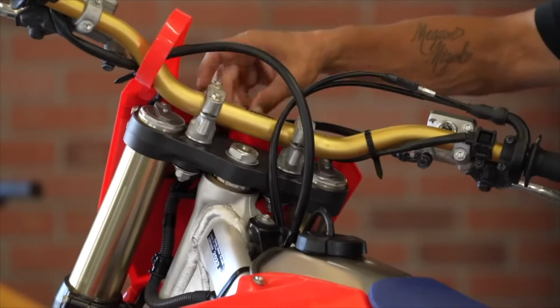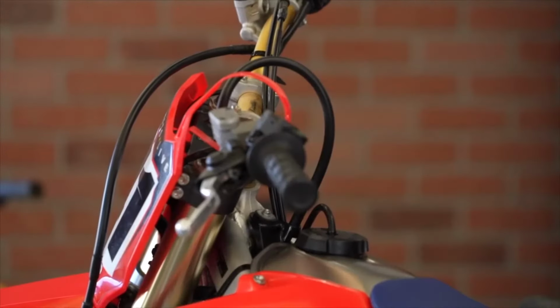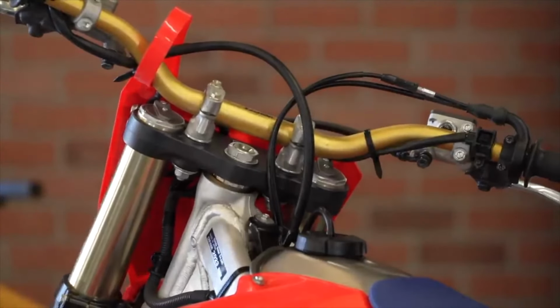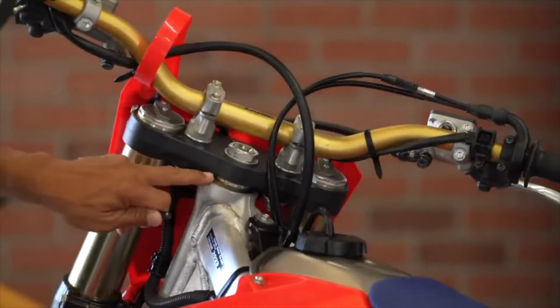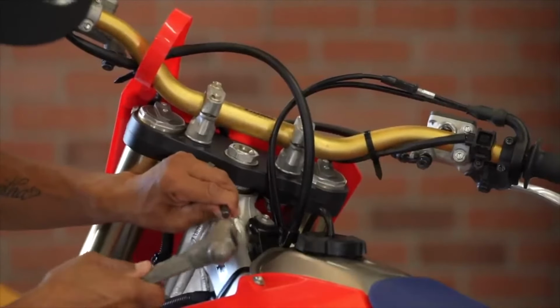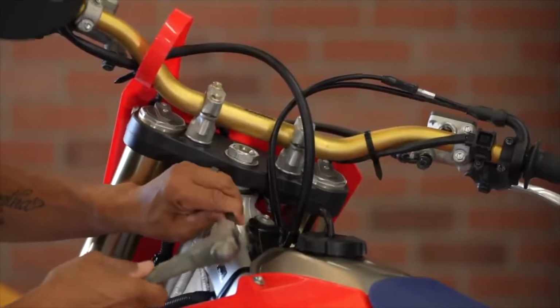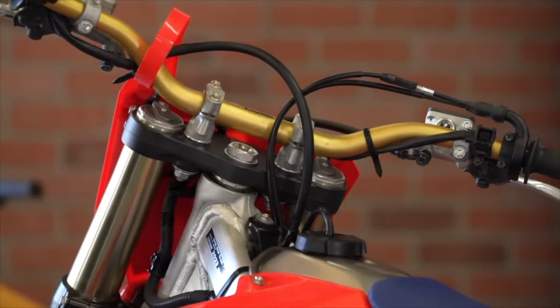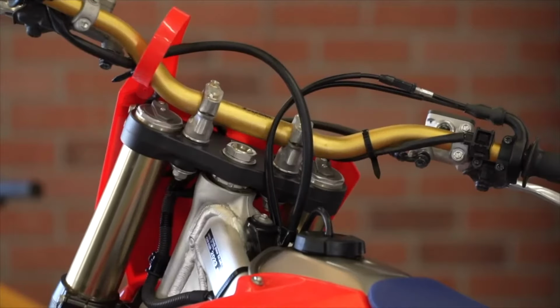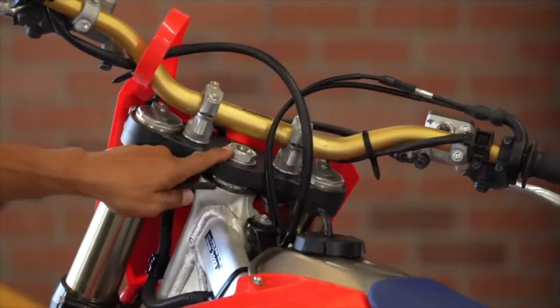Okay, so we've got the nut loose. Tighten the little spanner with a wrench and punch. So what you do is you take the punch, and there's little slots in the bolt or in the nut, and you tighten it as such. So you want to check the tension. Look at that, just right. Baby bear's porridge. So once this is tight, you tighten the spanner on top.